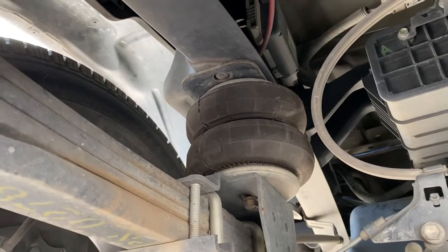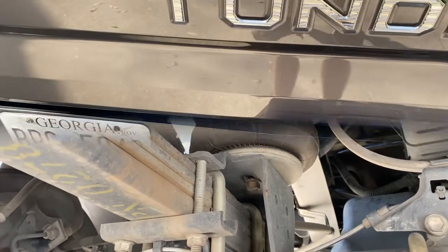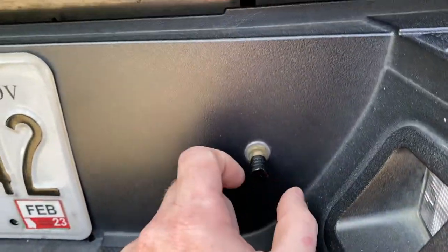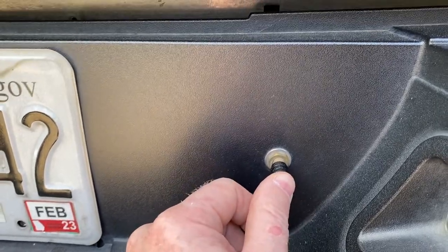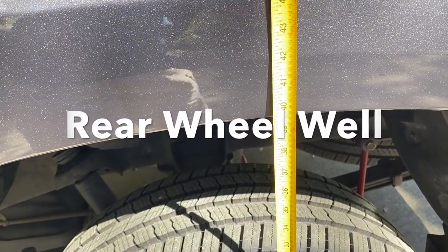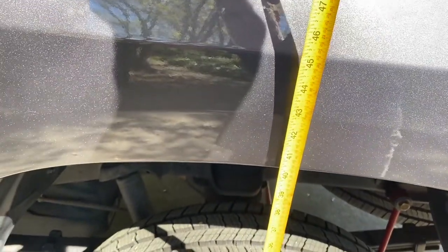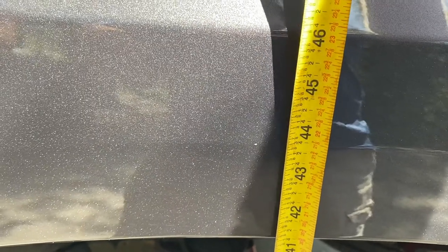In addition to the sway bar, I've added airbags. In general I leave them inflated at 5 to 10 PSI and inflate them to 30 PSI when I travel. I had these relocated to just one Schrader valve — the two pieces of piping theoretically would each have one valve, but I drilled a hole through the plastic part of the bumper and teed them into one valve, since I don't carry uneven loads. The height of my wheel well is right at about 39.5 inches. At 30 PSI it goes to about 40.25 inches, and at 70 PSI it reaches about 41.5 inches — almost two inches of lift.